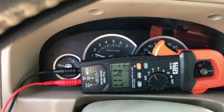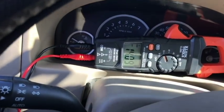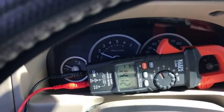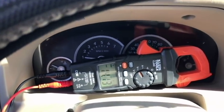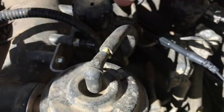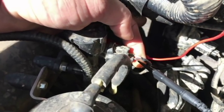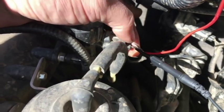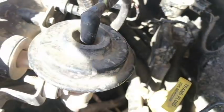Now I'm going to turn around, hook it up to the other wire, and drive back. Now I'm hooked up to the red wire. We are maintaining — no matter what speed or how much demand I have — we are maintaining charging voltage on that wire. Which would mean that the white wire on the back of this solenoid is our main 12-volt feed or power feed wire, and that the black one with the red tracer or pink tracer is our signal or command wire.